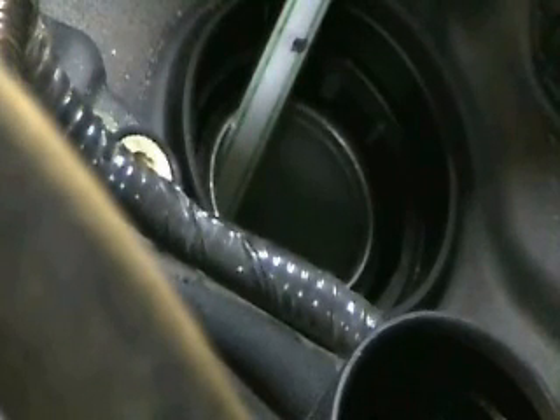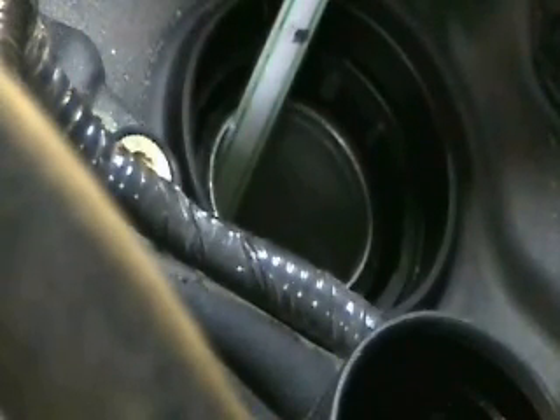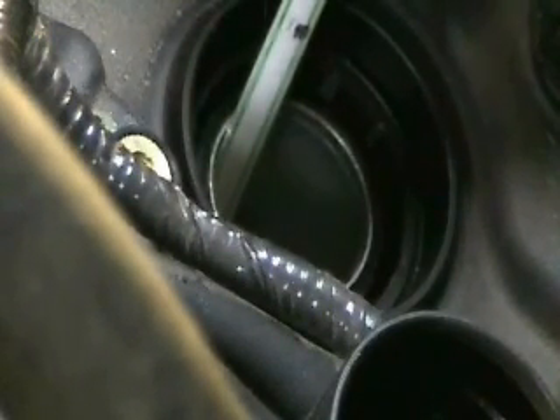When the straw gets to top dead center, I want to keep going so that I see the straw moving down again and then stop. I want to carry the piston to the downward stroke past top dead center just a little bit. So let me go ahead and turn this ratchet here. It should be just about at top dead center. Now it should come on the down stroke and it's going to have a little gap here because of the rod knock. And now it's moving down.